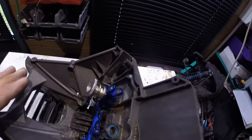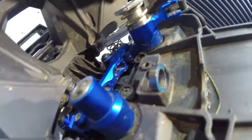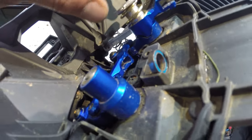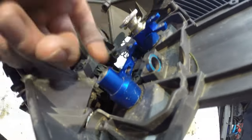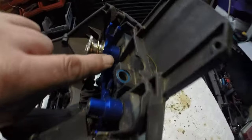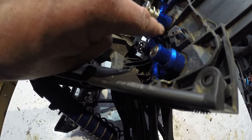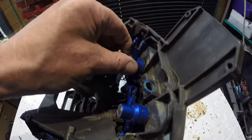Right guys, looking at this servo saver from GPM, you believe this is the cause of the problem. They are so deep, these teeth in there. That spring is virtually undone. It's only on by a couple of turns on the thread, and it don't even jump over the top. Don't even start to compress the spring. We reckon I'm gonna have to grind some of this off the back here, so that at least it'll compress and spring rather than beating the servos to pieces.